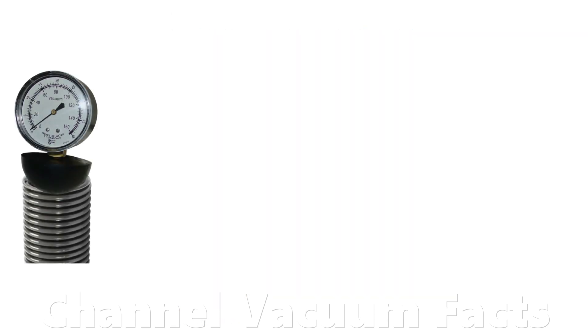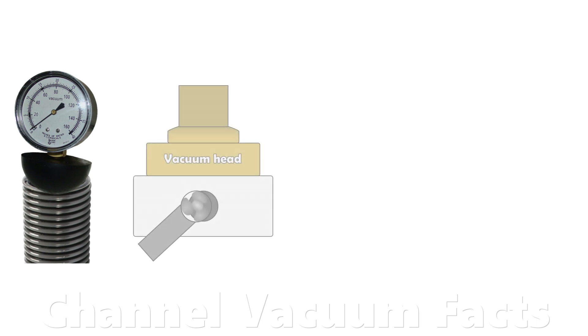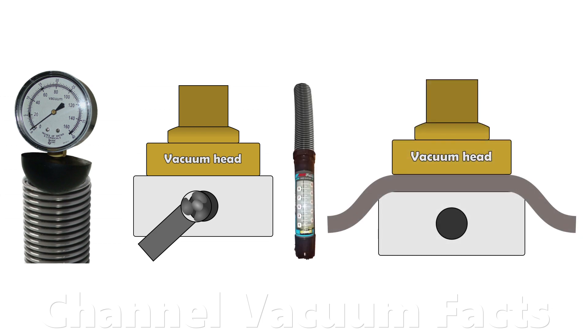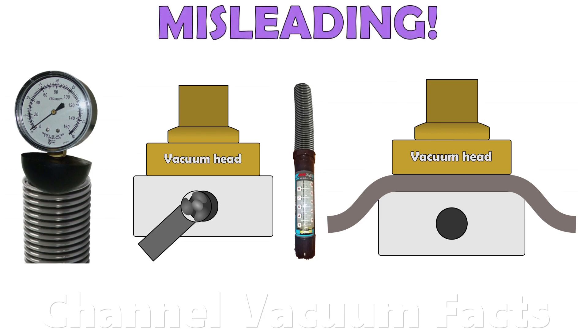In summary, if you ever see videos measuring suction pressure with a gauge at the open hose, short circuit airflow through a hole in a box using a spinning turbine or airflow meter, or near short circuit airflow with a porous rug over a box or something equivalent, then recognise it's not representative of real world usage and doesn't provide anything meaningful to help draw fair conclusions about a product. I hope you found this video useful and thanks for watching.